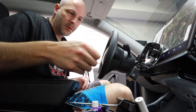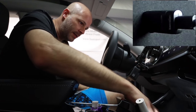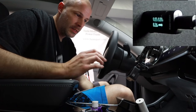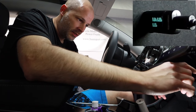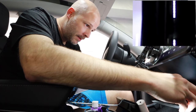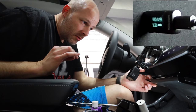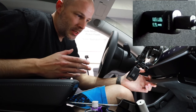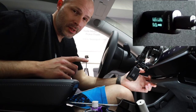Now what we want to do is take the cord from the factory USB port wireless charging cable and plug that in. Very interesting — right away we get nine volts, fluctuating a little bit because I think there's a computer readout in the charger itself taking a little bit of power. We're going to set my phone onto the charger wirelessly. We're still at nine volts, but it's ramping up. With only one phone on the wireless charger, we're getting 9.7 watts at nine volts. Very interesting.